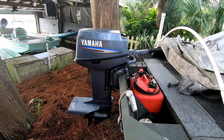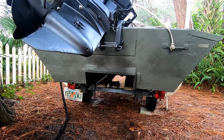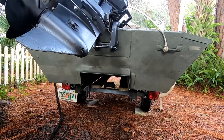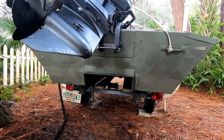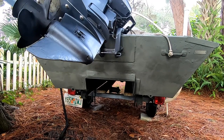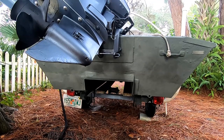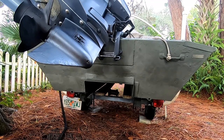But I finally got it and I'll show you how I installed it. A while back I did a short video on this tunnel extension that I added to extend the water column out towards the lower unit on my 25 Yamaha. I found this cavitation plate from a company and it's specifically made for my Yamaha 25 — it's even color painted to match, which surprised me. So I'm going to show you this latest extension to keep this boat skinny.